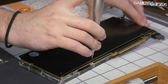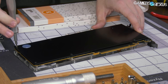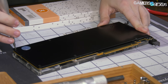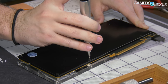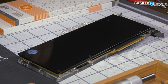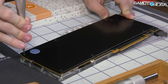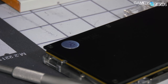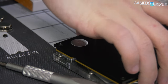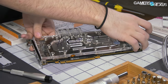So then we get to flip it over, see how it looks, and add all the fittings. From there, we'll just have to fill the loop, get the pump situated — we have a pretty nice pump to go with our 360. The GPU will be completely isolated in its own loop and probably won't be using the Vardars that come with this. They're very good fans for noise-normalized performance, however we want absolute performance. We're probably going to use Sunon Maglevs, which is the supplier for the Corsair Maglev fans. And there's the RIP LTT Titan V — looking pretty damn good.